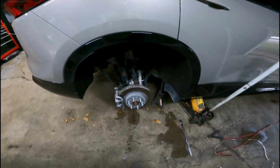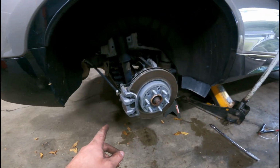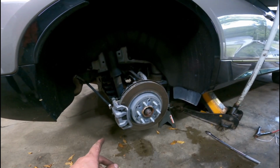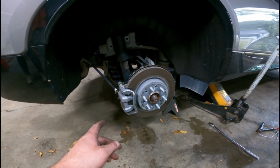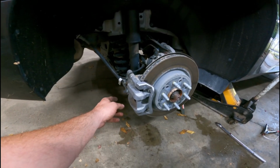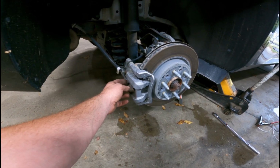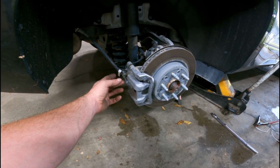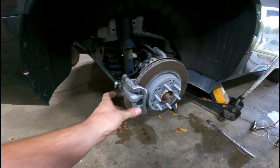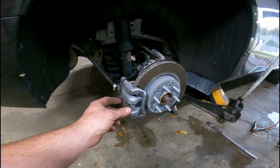All right, as far as rear brakes go, it's becoming real common with modern cars, some of the older ones, but maybe more classy, like the Lincolns or Cadillacs or Maybachs, stuff like that. They got electric e-brake, which when you engage it, either applies more brake fluid into the piston to make it a tighter squeeze, or it kind of screws out a little bit like threads, bringing the plunger out more and gripping on the rotor.